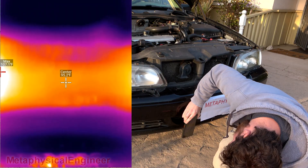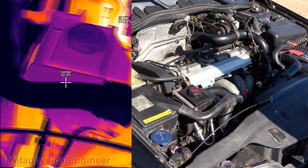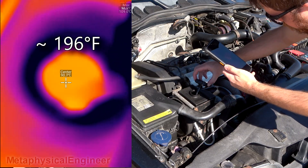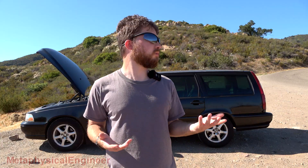You can see the sharp drop in temperature when the cooling fan kicks in. A little bit of a warm day — not as warm as the worst case in some areas I'll drive in, but warm enough for a test of the cooling system. Taking a look at the power steering: how warm is this after a winding mountain road? 91 degrees — not bad at all. It would almost get that hot before just cruising around town on a mild day. I'm going to call that a successful test of the power steering cooler. This is about the worst-case scenario the system's going to see: slow speed, back-to-back hairpin turns, climbing a mountain on a warm day — and it only got as warm as it would get just doodling around town on a mild day before I added the cooler. The pump and the rack are going to be a lot happier running probably 50 Celsius cooler under extreme conditions. With the new high-pressure line, replacing the rubber parts of the return line, and adding the filter, this system's going to be good to go for quite a while longer.